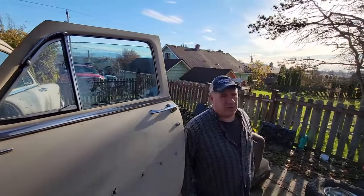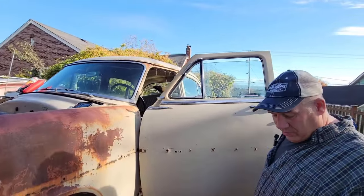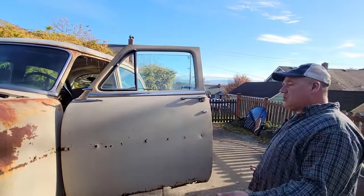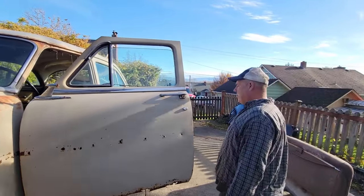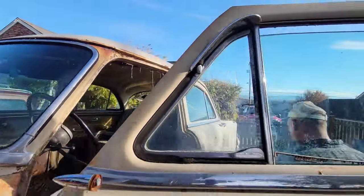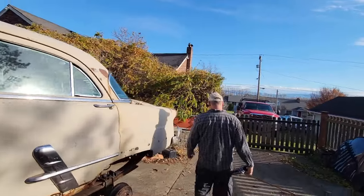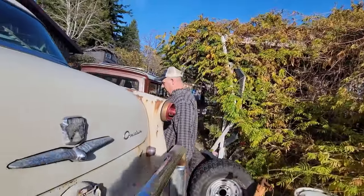That's a sign of a bad master brake cylinder. The rubber will peel open and it won't push any fluid. We'll verify that by trying to bleed it. It could just be that it's so full of air, but I think it's the bad master cylinder. Bring your camera around here and set up on this back wheel. I'll break the bleeder off and then we'll go get a new wheel cylinder.